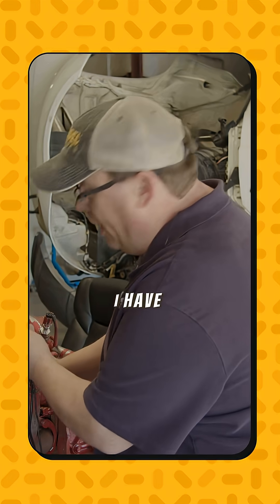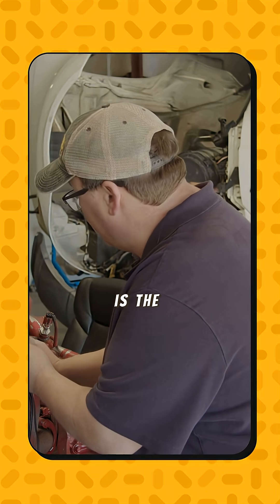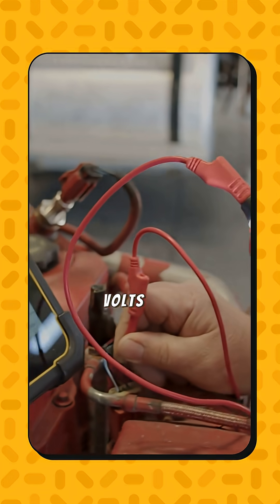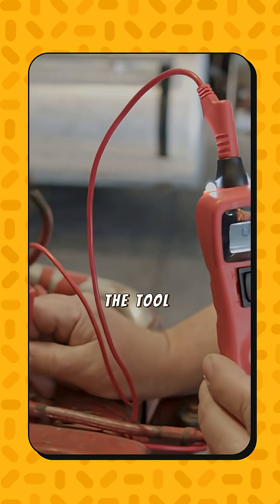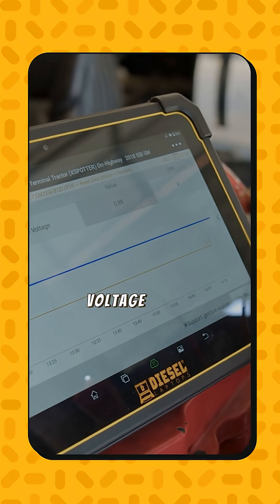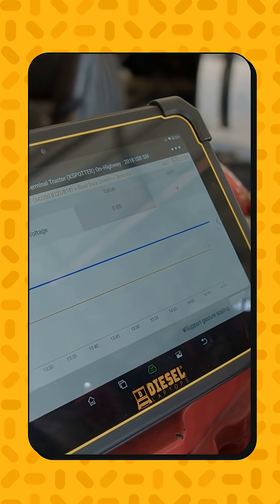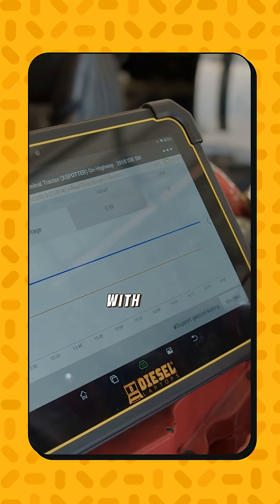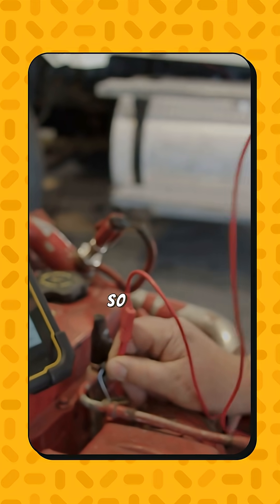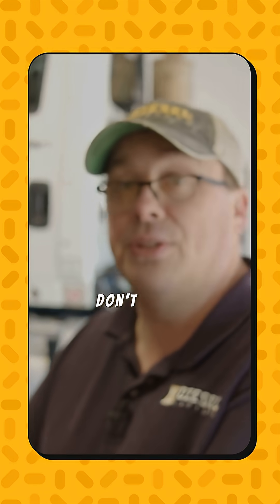Now I know I have a good ground for the sensor circuit. The next one I'm going to check is the signal output of the sensor. I have 0.9 volts on the tool, and on the scan tool my exhaust gas pressure sensor signal voltage says 0.88 volts — that's very close, good enough. What I'm seeing with my power probe three and what I'm seeing at the scan tool matches, which tells me all the wiring is good going to the sensor and I don't have a problem.